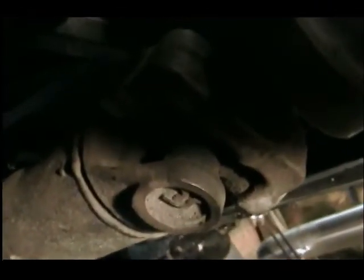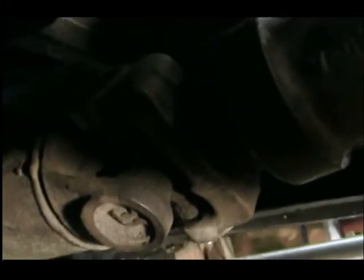This yoke here — where they machined it right here, where the shaft goes into the transmission — there's no radius right in the corner. That's not a good thing; that's a good place for it to split. But as long as I don't really try to kill it, it should last a little bit.